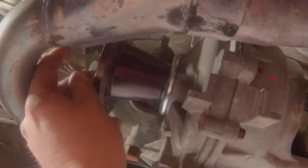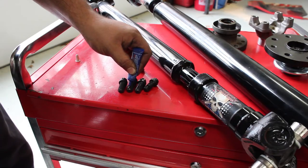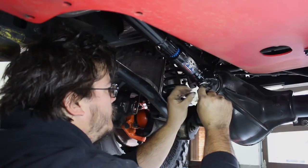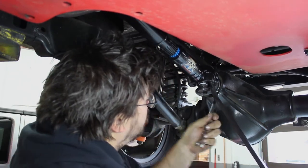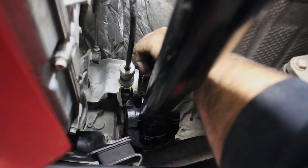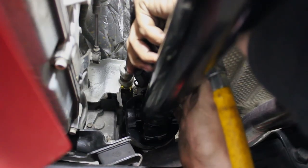Since Shifty has no respect for our tools or fear of bodily harm, he's using a small extension so he can wedge in a crowbar and torque the nut. You'll need to apply a drop of Loctite to the transfer case yoke bolts. Now you can install the front driveshaft. Install the front U-joint straps, but don't tighten them too tight or you will crush the caps. Now tighten the bolt at the T-case yoke. In some rare situations you may have to trim this little tab on the shift linkage bracket — easy enough to do with a pair of snips or a body saw.